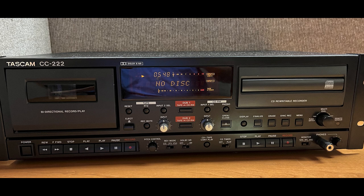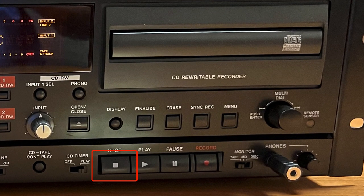When the available recording time on the disk is finished, or the tape has stopped playing according to the reverse mode setting — whichever is earliest — the tape will stop and recording will stop on the disk. You can also stop the dubbing process by pressing either of the stop keys, which are the only keys that will work in dubbing mode.